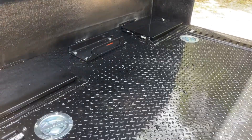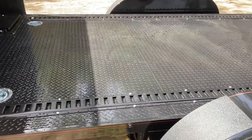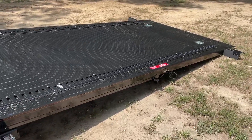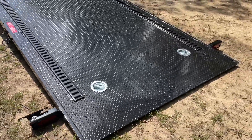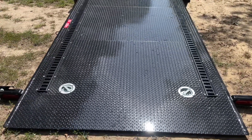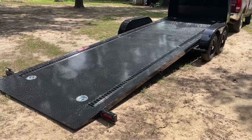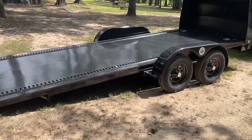Standard it comes with four 6,000-pound swivel D-rings, but E-track is getting extremely popular. It seems like the majority of my customers' cars are sitting on the ground basically, so it's really hard to get underneath to tie them down. E-track is getting really popular — the over-the-wheel E-track straps. There are several different manufacturers out there, but I'll be honest, I think Max Straps has the best ones by far and I think most people will agree. Standard configuration LED lights. This is a 22-foot but we maintain the 5-degree load angle — as you can see it is extremely low to the ground, which makes loading really low cars super easy.